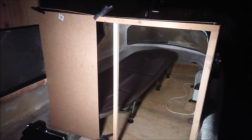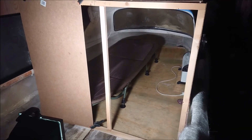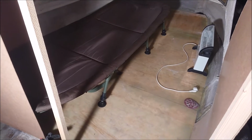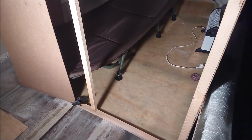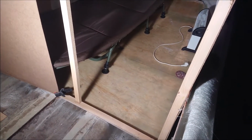Right, this is part 2 of the building progress, or process at least. I'm almost finished with the floor, and I have used 10mm thick boards and just painted the underside of them with polyester, and on the top I have used fiberglass and polyester, one layer, and now I have started with the extension of the hard top.